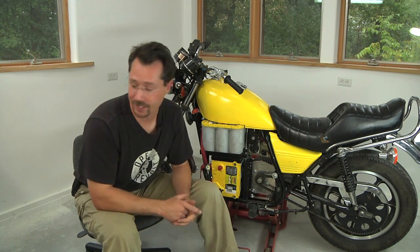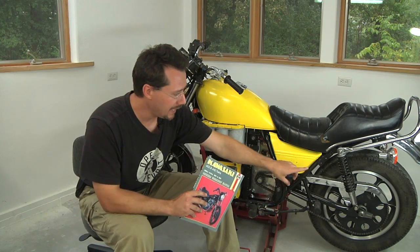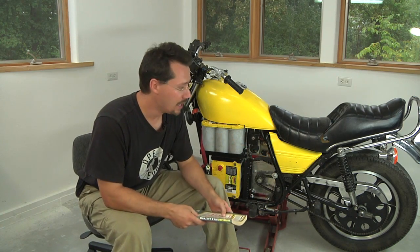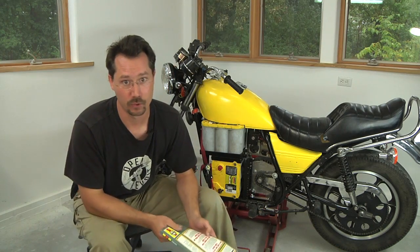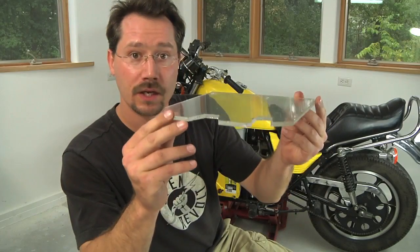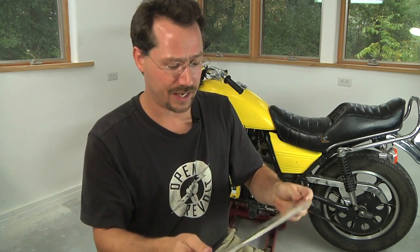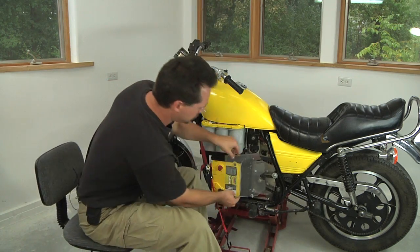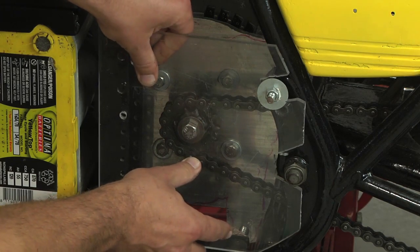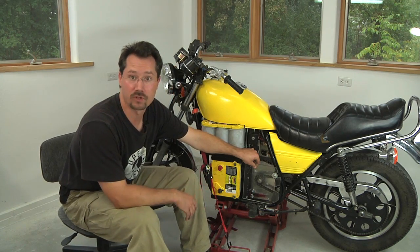In the meantime, all we really need to do is make sure that we tension the chain according to the user's manual and tighten and align the back tire, just to make sure everything is to spec. A chain guard doesn't have to be anything too fancy — in this case it's just a piece of plexiglass cut to the shape to cover the chain. That simply goes over the chain here with a couple of screws and a nut and bolt to hold it in place.